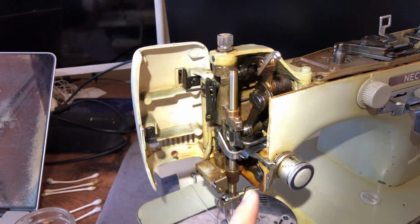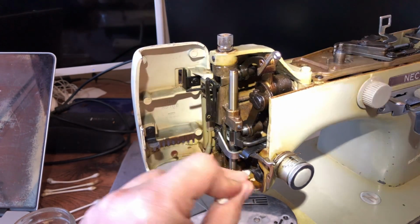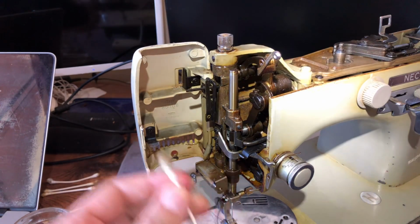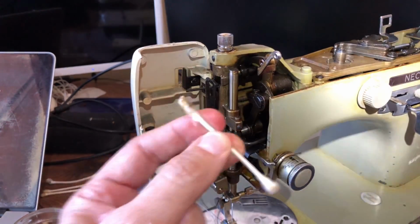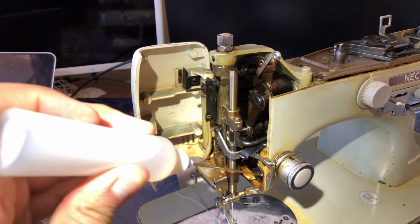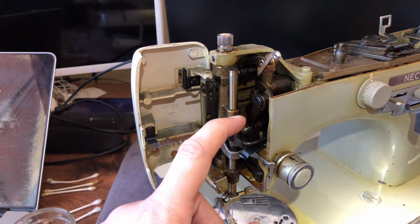But don't feel like you have to go in and clean. You can see down here, there's some old varnish. You can see when I pull on it, I've got some of the liquid oil, and it's starting to break up some of that. But this is not dust. It won't get into the workings of the moving parts of the machine, and it's not really going to hurt anything. And when we get underneath, I'll show you guys where sometimes having old oil on parts that are not moving and not critical for performance and function can actually be your friend.